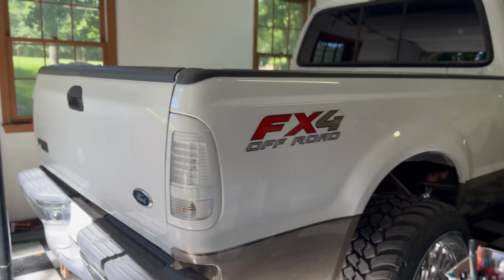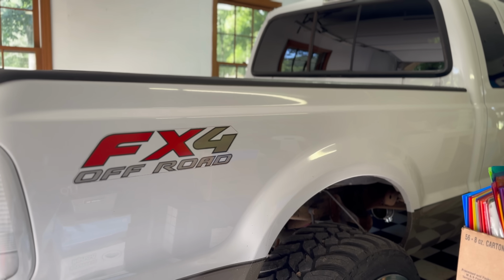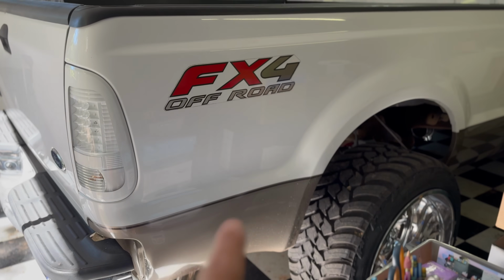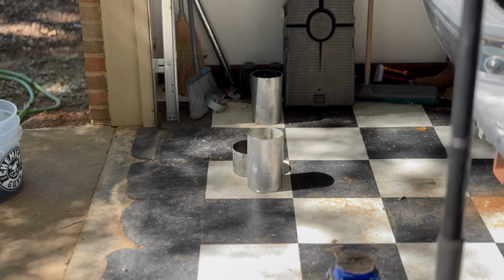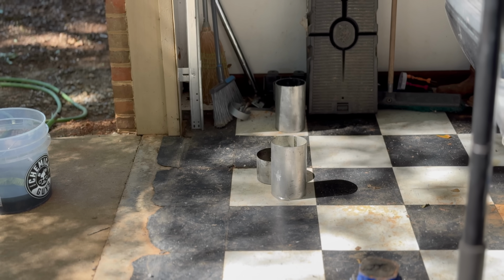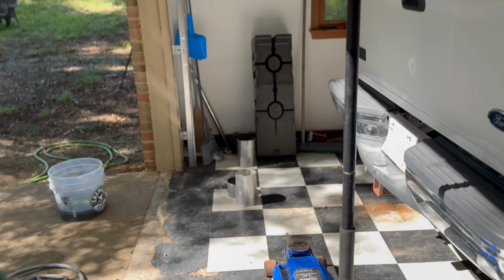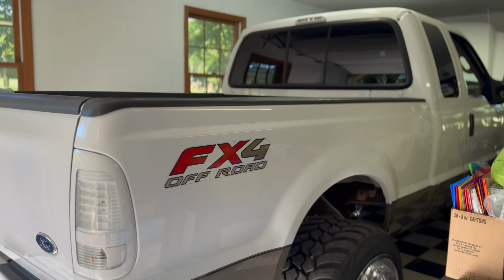So one problem fixed, and then immediately another problem arose when I was leaving. You might see my exhaust detached underneath there. So I did a little pull, which obviously flexed the exhaust pipe. And I pulled up to the house and something was jingling around. So I looked under and this entire portion was just flopping loose because the clamp down there came undone, the pipe, everything. Because that little mid pipe that I had to add, the one in the middle, I guess technically, the shortest one, is not quite long enough, so it separated and the exhaust basically fell apart. So I've got that other piece that I'm gonna cut down to size, but then my Sawzall died, and so I've got a new one ordered. I'm gonna get that cut down. We'll get our exhaust hooked back up and be ready for the next video.